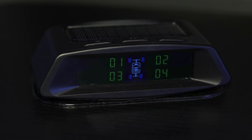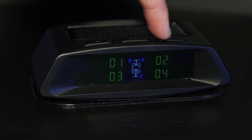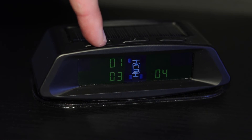Press the plus button to go to the next setting. This option of the settings menu allows you to change the wheel position for when a tire rotation is done. During wheel rotation, the positions of the internal sensors change. To adjust the position of the sensor on the monitor in accordance with that of the vehicle, press the set button once and you will see the first tire icon start flashing. Use the plus and minus button to choose which wheel you would like to change. Once you have located the tire position you would like to change, press the set button once. You will now notice the tire position numbers start to flicker. By using the plus or minus button, select the tire's new position. Press the set button once to confirm your selection.